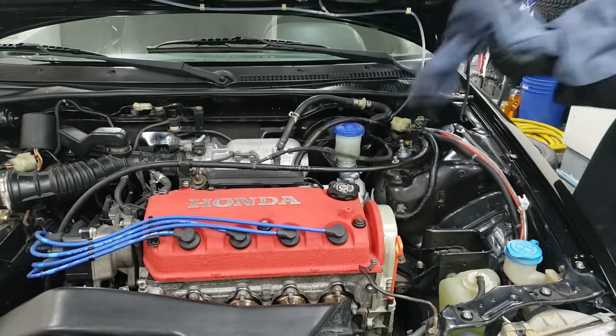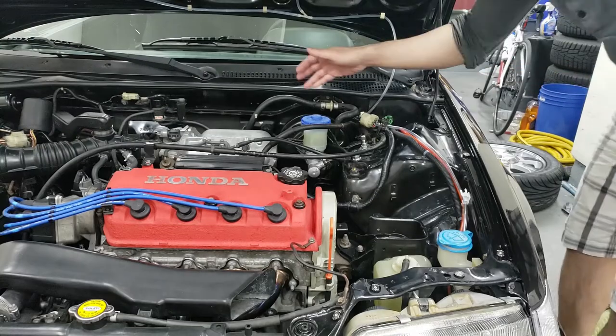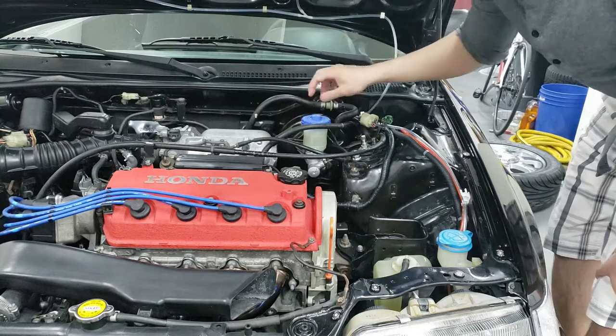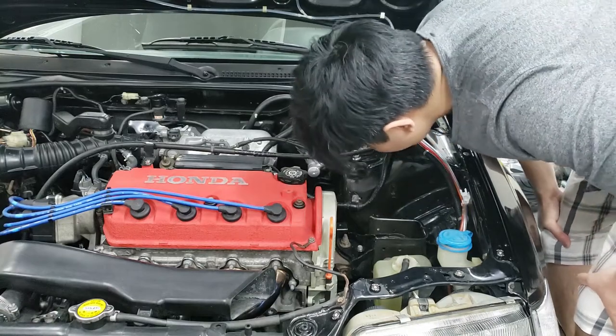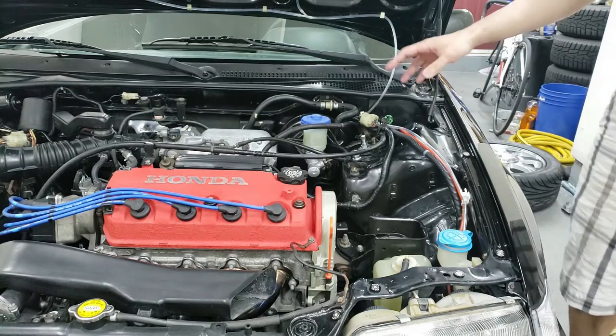All right, let's get some brake clean in there. We'll wipe everything up. All right, guys, so I have tightened down the master cylinder. These bolts that go onto the brake booster are supposed to be at 11 foot-pounds. And I tightened down the brake lines as well. They don't look like they are leaking or anything, so I think it's good. I've also sprayed down the whole area with some brake cleaner, so I think that's good.